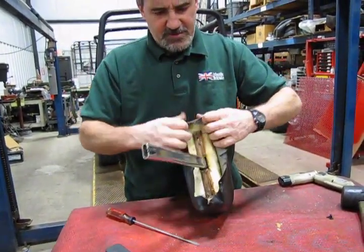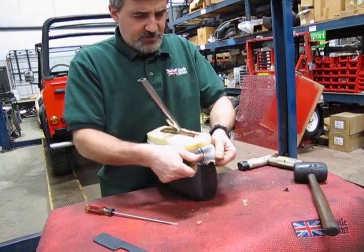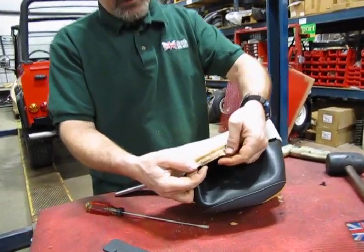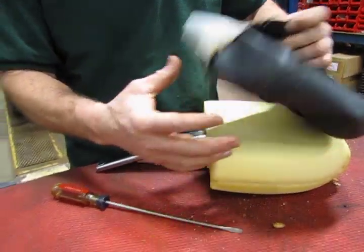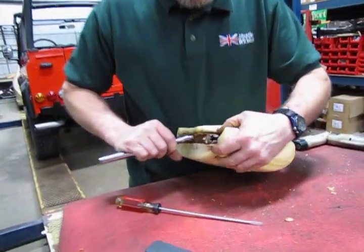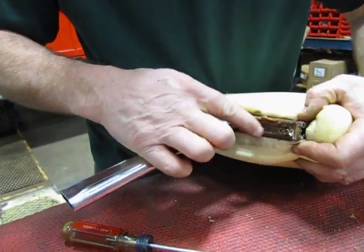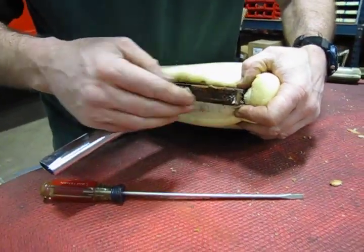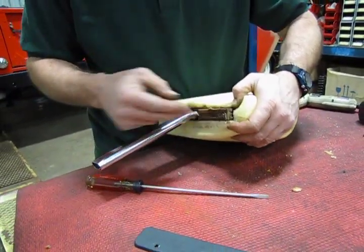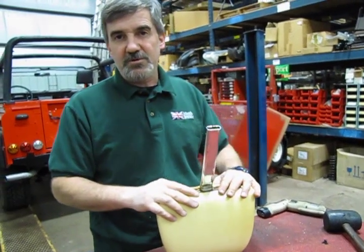Just like we did with the seat cover, you start from the bottom, fold it over, and peel it right off. You can see what happens over time — you get rust and corrosion built up, and after a while it weaves through and you can see it through the material. At the bottom of the headrest, there are two metal tabs that can be bent out and the wooden block taken out. Measure it, cut a new piece, slide it back in, bend the tabs over, and you get a fresh piece of wood. If the wood is still fairly solid, you should be able to reuse it easily.